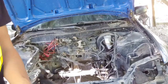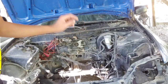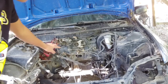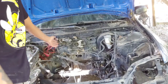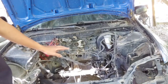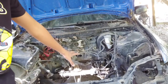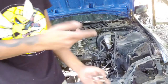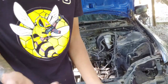Everything inside this car is coming out. I'm going to take the whole rack out because that's a power steering rack — we're going to need a manual rack. We're going to take all this evap system out, the fuel stuff, this extra mat that we definitely don't need, the brake booster, everything. I'll start unbolting everything, making this completely bare inside the engine bay.